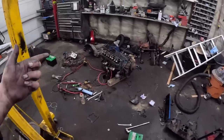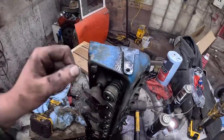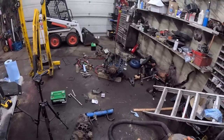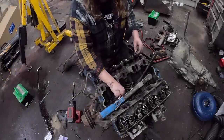Okay, so the other cylinder head's all kind of cleaned up, hosed down with brake clean. We got the reman head on already. We got the brand new head gasket sitting on there. So yeah, these things are all dried off from the brake clean. And we're ready to slap this bad boy on there. And then head bolts, and I mean, really, short list, this thing will be running in a couple hours, an hour. So we've got one cylinder head on and the head bolts in now.